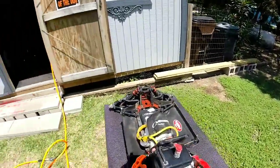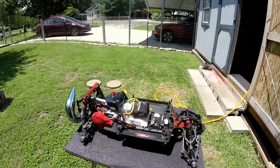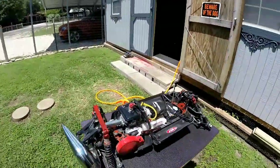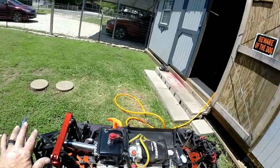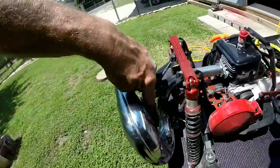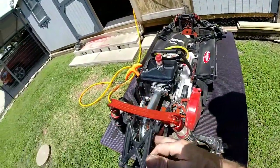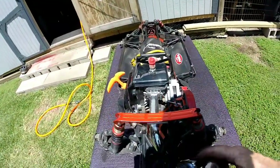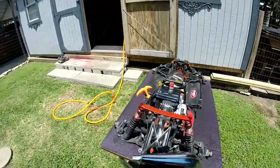As soon as DDM has the Bartolone side mount pipe, we're going to do that because this just bends too bad. Now you'll see, the two crashes after that didn't bend. I didn't hit on that side, but you can see where it's melted this brace. It's a little bent right here, that's why it's touching. So I'm gonna heat this up again, put it in my vise, and we're gonna straighten this out until we can get that side pipe.